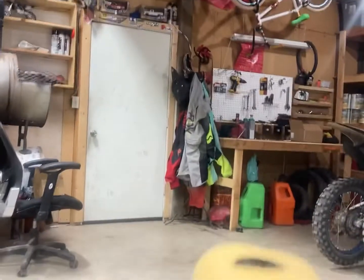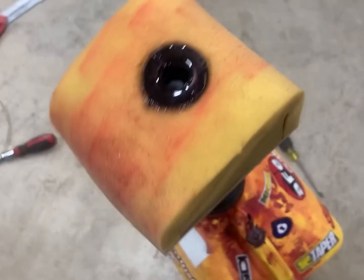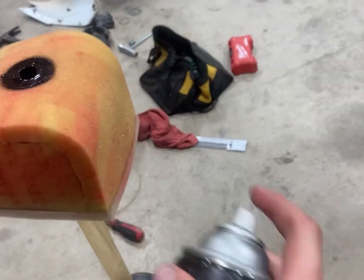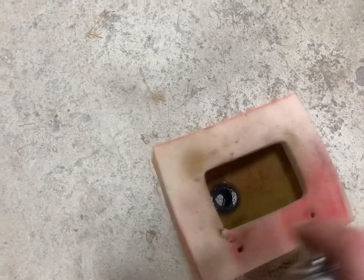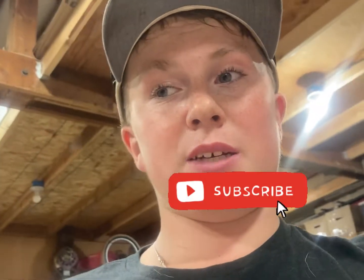Once your air filter is dry, take some PJ1 air filter spray and just coat it - a nice amount, just enough - on each side. You also want to flip it upside down and get the seal. There you go, now you got it clean, then we got to put it back in. Just like we started, you put everything back together the same way it was. Now we've got a new oil change and an air filter clean on your dirt bike. It's a pretty simple task - probably the longest thing is letting the filter dry, about half an hour to 45 minutes maybe. Awesome guys, thanks for watching, please like and subscribe, and let us know any other videos you guys want to see.